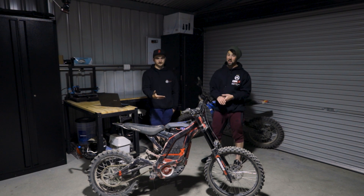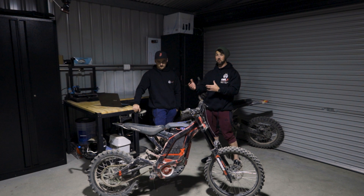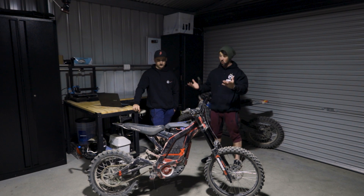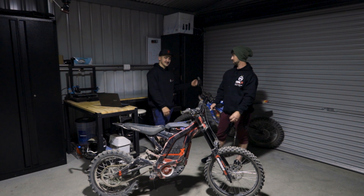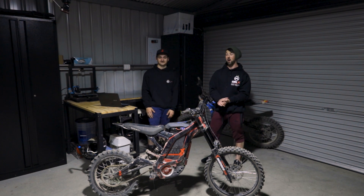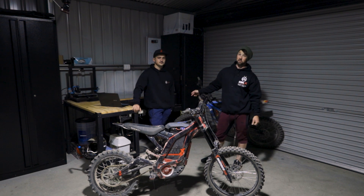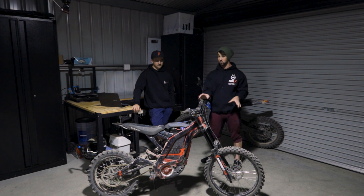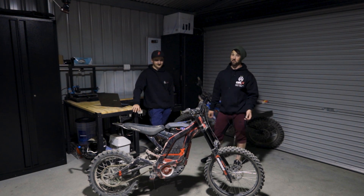But more top end. Truett in this tune essentially has the same RPM map between the bikes. Truett runs less phase amps — over a hundred less phase amps. I run 620 phase amps versus 765. And this feels like it has more torque. This is a heavier bike, but with the extended swing arm, this is a rocket — the wheelie power, the front wheel popping power is insane.